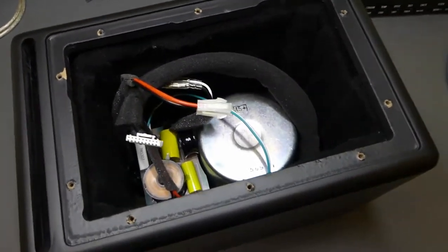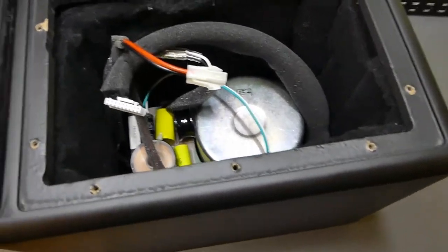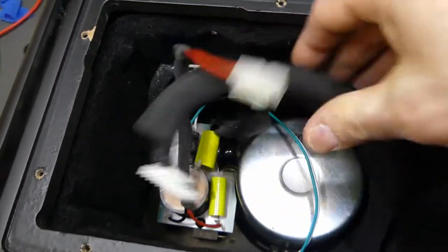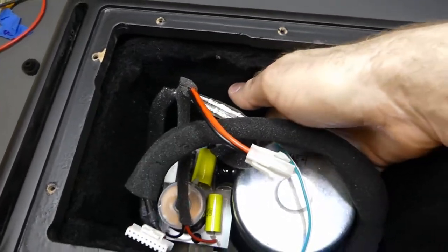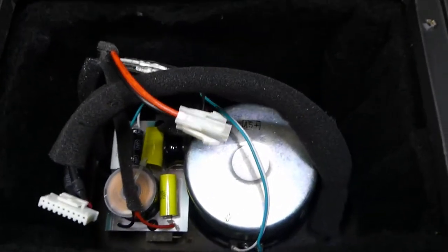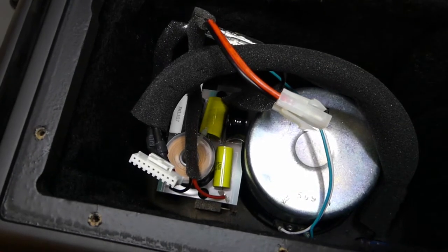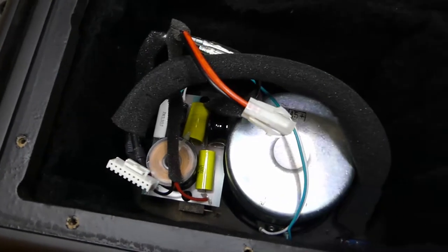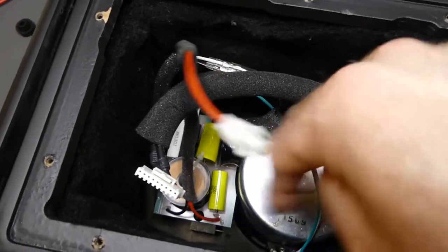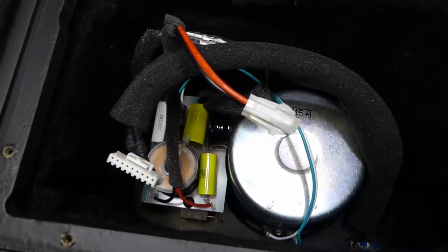This is the rear of the 5 Plus with the amplifier removed. The large driver here is the mid driver — it's fairly substantial, at least the cover on the magnet, which I think is for shielding. Then you can see the analog crossover board, which actually serves both drivers. It's not just a simple capacitor first-order filter for the tweeter — they're doing some additional filtering for both units.